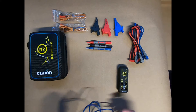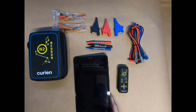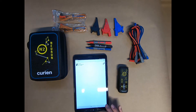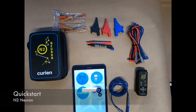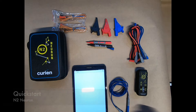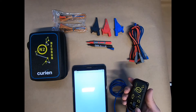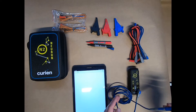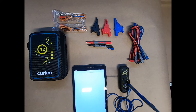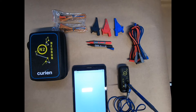To get the N2 to turn on, we're pulling up a tablet here. We're going to try and do the wake-up for the N2. Let's go ahead and scan — we shouldn't see any N2s. Now we're going to come in and connect the common port, then come over to the resistance port and hold it there for 10 seconds. It may not take as long for you, but if you just scan, we should see it wake up — and here you go.